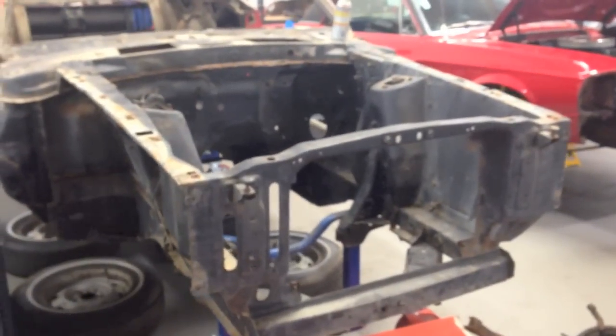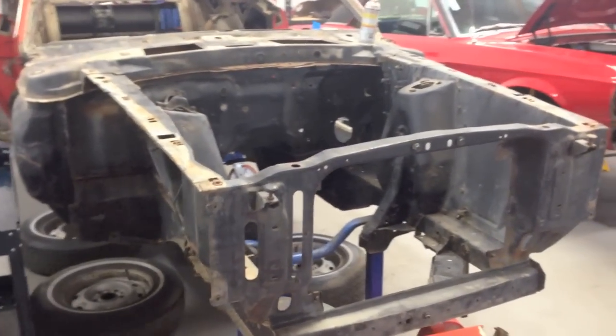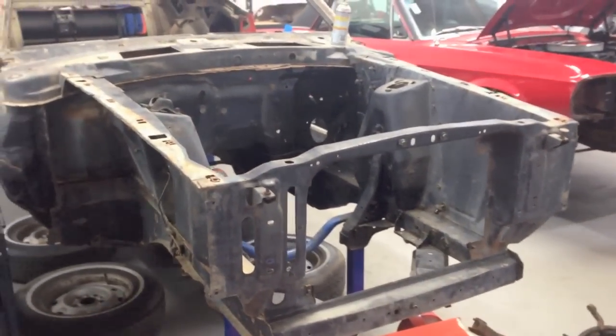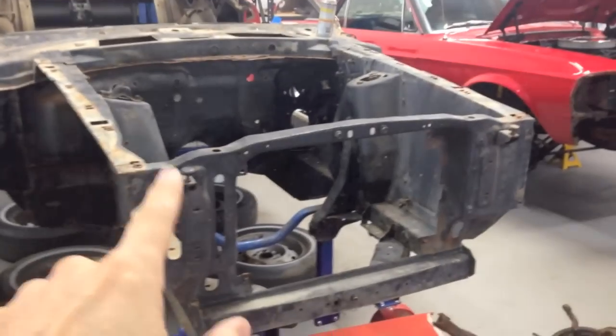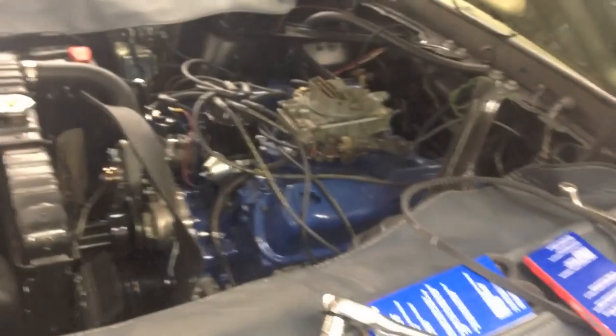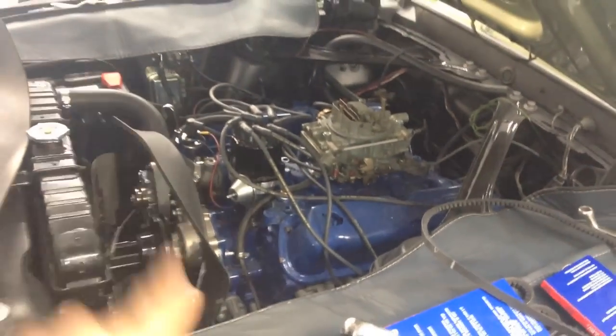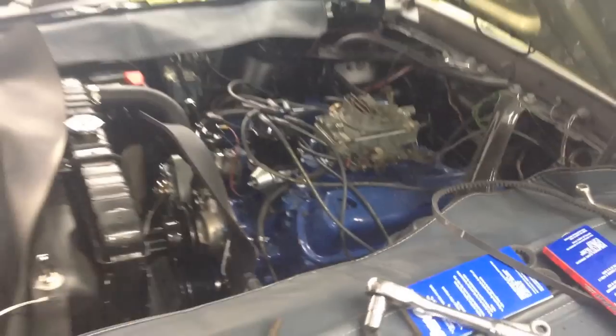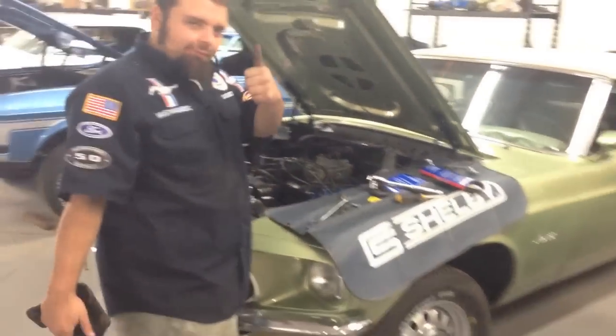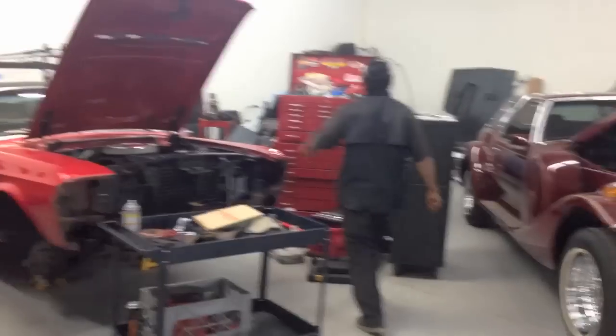A lot of love going on the 69 GT - multiple air conditioning brackets, and we've got the parts for the AC Windsor. Those are Yorks for his 351 Windsor. We're doing 30-over pistons on this car with standard bearings and a Stage 2 cam - you're gonna be happy with that, it's going to give a lot more power to the 351 Windsor. Over here we've got a Stage 1 cam in the other 351 Windsor that was also rebuilt by us, and we're gonna get her running today.